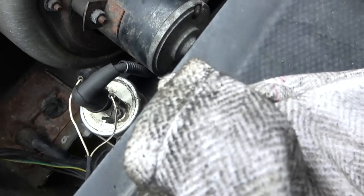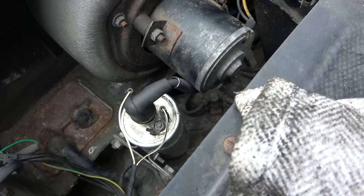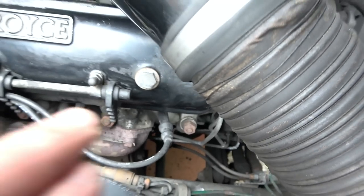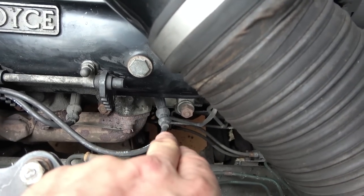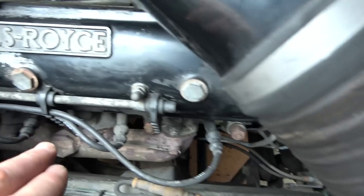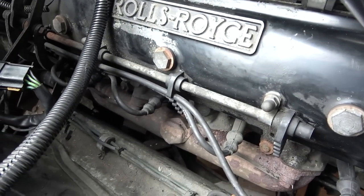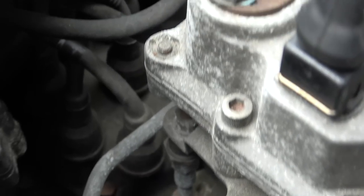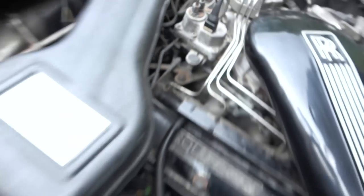and up there. Look at what I found down here, the coil. So obviously this is before you had coil packs and stuff. This is the coil, and so there has to be a distributor. We've got eight cylinders, so there's one spark plug lead there, HT lead, high tension lead, there, there, and there. So there has to be a distributor somewhere. There it is. Just seen it in here. Look, massive thing. Let me get a torch.